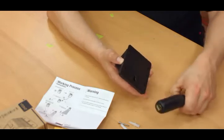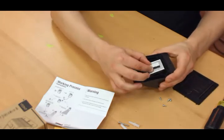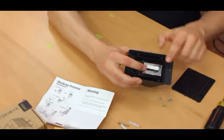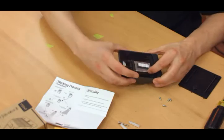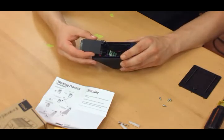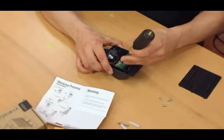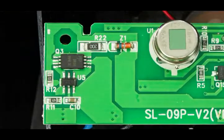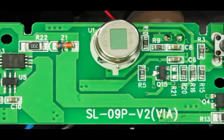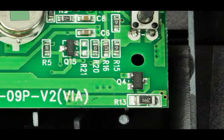The back is held on by four screws with heavy threads that are driven into the plastic of the case. With the screws out, the back falls right off, and there is indeed some waterproofing in the form of a U-shaped gasket set into a channel surrounding the internal components on the top and sides. A medium-sized flat lithium cell under the cover is held firmly in place by the pressure of the cover against a foam pad. You can see indents on the foam caused by the ridges on the inside of the cover plate. Under the cell is a very small circuit board with extremely fine wiring, especially those going to the LEDs. It appears that the wires are perhaps insulated with lacquer or some other very thin coating. The circuit board is fastened with two small screws at diagonally opposite corners.